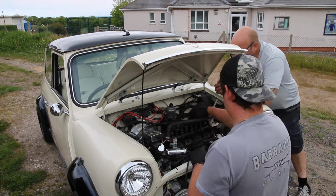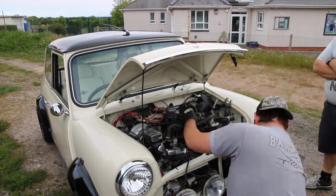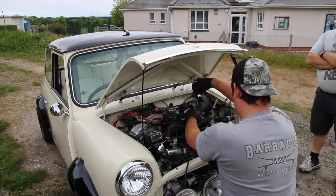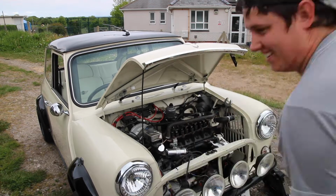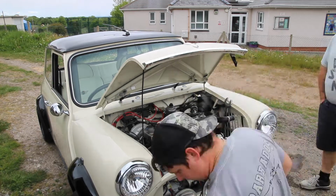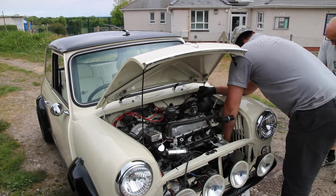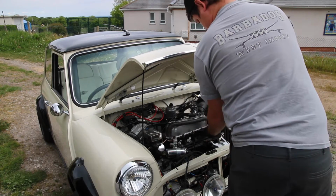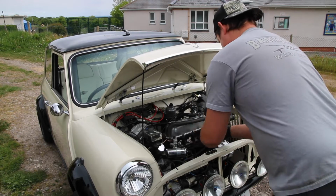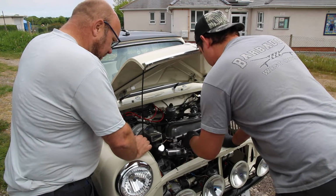Unfortunately, it just seems like a bit of a blip there. So with the valve clearances now complete, they're adjusted to 12 thou, and the largest of the gaps was over 80 thou of clearance, which is just insane. There was far too much play in there. So hopefully just adjusting these clearances will improve the running of this engine.